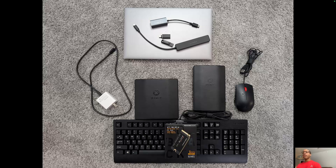I needed to use a wired mouse and wired keyboard because the built-in keyboard and trackpad both did not work upon the initial boot-up screen to start the installation process. You'll also need the new drive — I'm using a Western Digital Black SN770M. So far it's fine; I haven't done too much with it as of recording this video, so hopefully it lasts a long time.